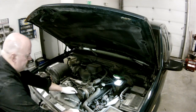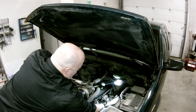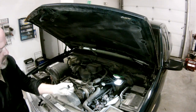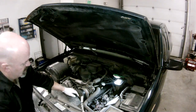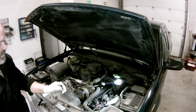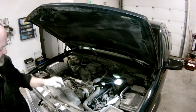I was highly suspicious that coolant was entering at least one cylinder — it felt like a one-cylinder misfire. So I pulled out all the spark plugs and as I looked at them, they all appeared a little bit wet with a presence of coolant. I pressurized the system and had to add more coolant — at this point I'd added probably four to five gallons of coolant and water mixture. Some was ending up in the crankcase and some in the cylinders.